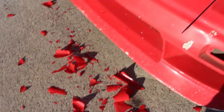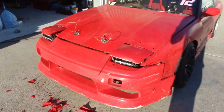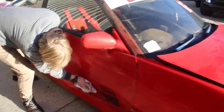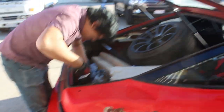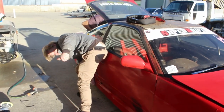All this paint fell off the bonnet but left no trace because it's just multiple layers of the same red paint - every bit that falls off there's more bits underneath that are exactly the same color. We'll give it a wipe to get all the dust off. Steve's taking the tail lights out because it's less effort than putting tape around them and it's cheaper. Normally you'd use wax and grease remover but we're saving money and using water.